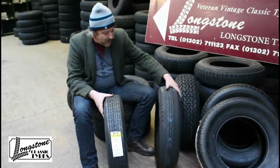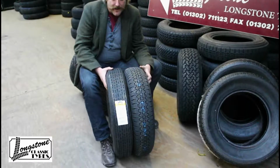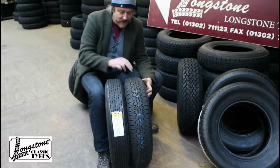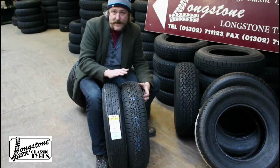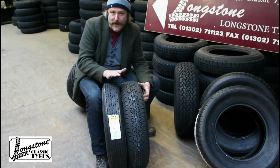Jag. So the range alternative to that was a 185/15, and very soon, in the mid-60s, AC went to 185/15s. This is just an example, we've got plenty of options, but this is probably the best one. This is the tyre of choice throughout the 50s and 60s. This is a Pirelli Cinturato. That'll be absolutely on the nail for it.